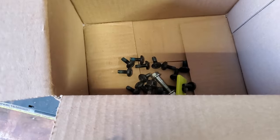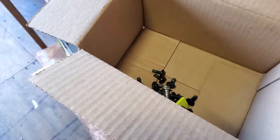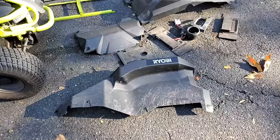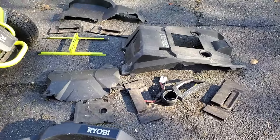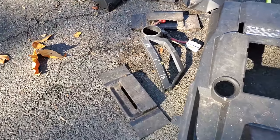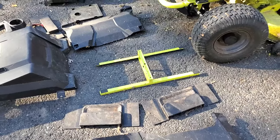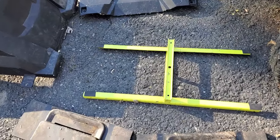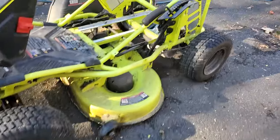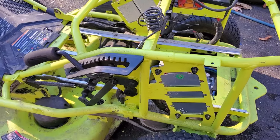Here's all the screws — I actually think there's a couple more bigger ones I didn't put in here, but that's all the screws it took to get this thing apart. This is all the pieces you have to take off to get to those batteries — all these pieces of trim and covers. They all have to come off, one on top of another. This here is the hold-down that goes on top of the batteries, and you cannot take that off inside the mower because it's got a shell — like a roll cage around those batteries — and they're held in there pretty good.